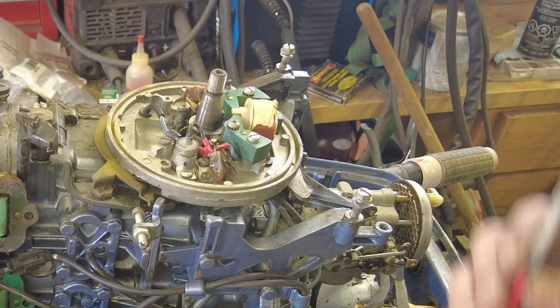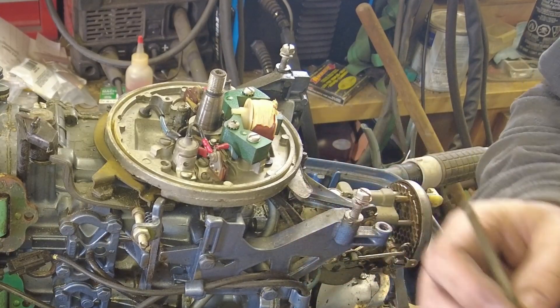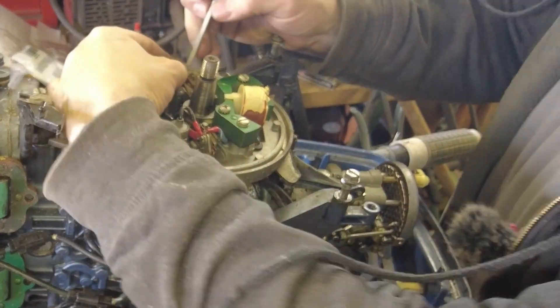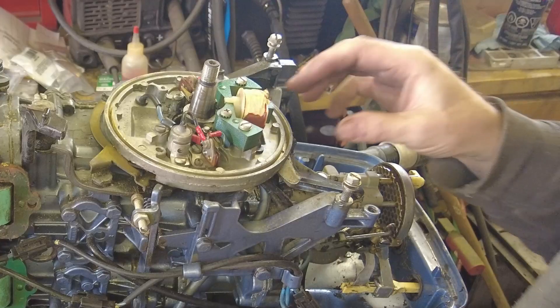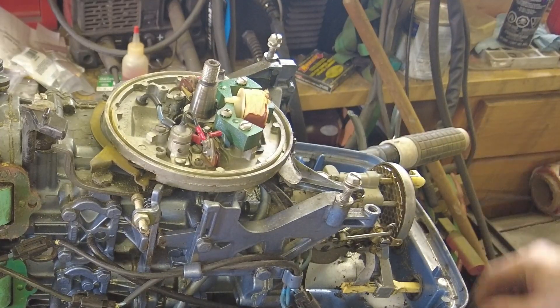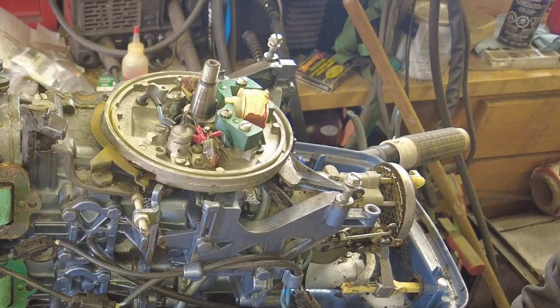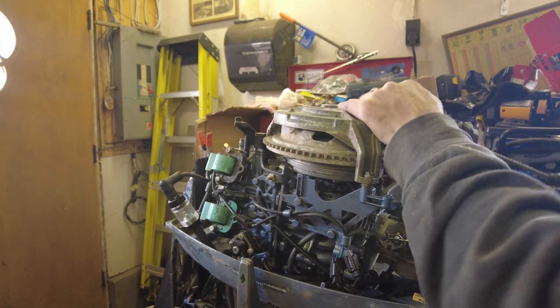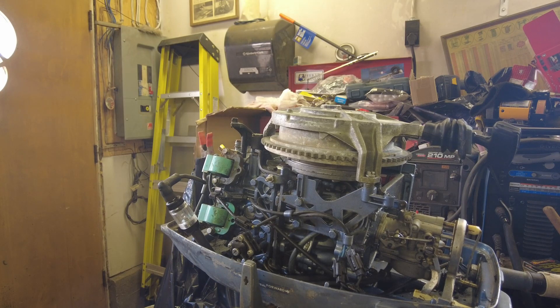Let me get a little bit of sandpaper — actually I think I might have a points file. Take a nice little flat fine file, slip it into the points and just give them a little cleaning up. Given the nice bright spark we were getting when we were grounding out to the recoil cover, I'm kind of surprised we weren't getting a better spark off of the spark plugs. Let me put the flywheel back on and we'll try it again. We are grounded to the spark plug this time. Off of the top coil, there's our spark tester. Oh, there we go — that's all it needed. That's what I wanted to hear. That's success — we've got it to fire. That tells me we probably have a good viable candidate and we can continue on.